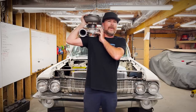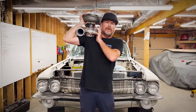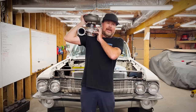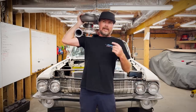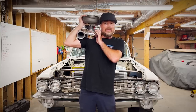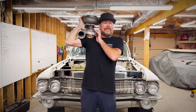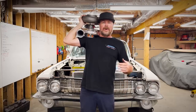In this video, I'm installing a pair of 88 millimeter Nelson Racing Engine mirror image turbos. They're incredible, and they're patented because they're mirror image — that means there's a left turbo and a right turbo, which means I can mount these symmetrically in the car, simplify the plumbing, and it'll look cooler. This particular one is what Nelson calls a street turbo, good for about 2500 horsepower. Its happy spot with the 11-blade wheel is between 15 and 25 pounds of boost, where it's most efficient — plenty to support all the horsepower I need to make the Caddy run an eight-second pass at the drag strip.